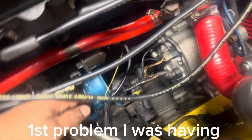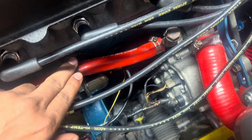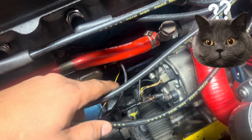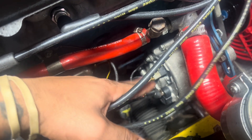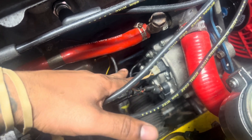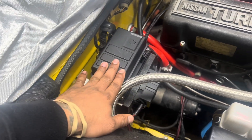Okay guys, here's an update. I figured out why the slow cranking was happening. This ground, for whatever reason, my dad by accident hooked it up to the alternator, which was draining it and causing some type of electrical power withdrawal that wasn't letting it crank. So, you guys already addressed that.